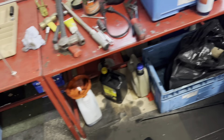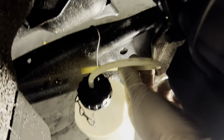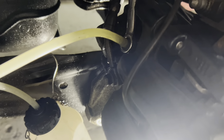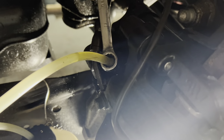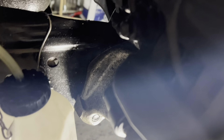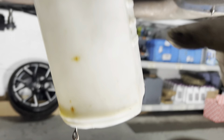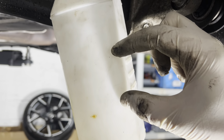I made a mess yesterday as you can see. I had a lot of work, so it's one of them days unfortunately — I'm going to tidy up later. Let's move this light out of the way because it's a bit too bright. I can put this bottle on the arm and get my spanner in here, and it should just crack open. Put your little bleed screw. I'm trying to do this one-handed for you. We're just going to ease this nipple off a little bit, just like this. Then we can see some fluid coming out. These callipers — there's not actually much room to do it. So I'll just drain until we've put probably about this much, then we'll do the same again up front.